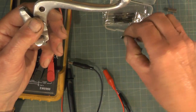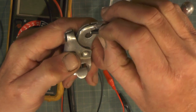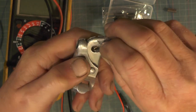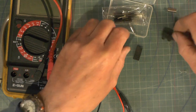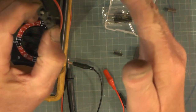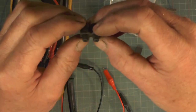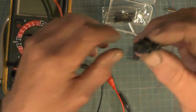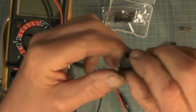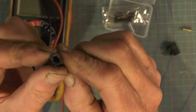Because these reed switches are quite small - I didn't realise they were this small actually - I've not got much surface area and protection to stick them at the bottom of my brakes. So my plan is I've got these electrical connecting blocks that come in a long strip. You just cut them off to however many you want, so I've cut them off into ones. I want two of these. I've took the screws out, took the brass middle out, then linished them on my belt sander just to make a square block - so that square block's now got a hole in it.